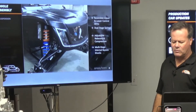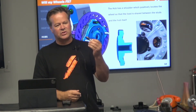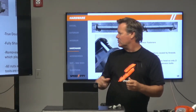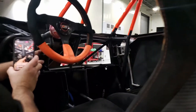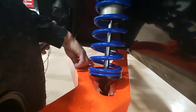Shoulder bolts everywhere. We've tried to explain the double shear concept a lot, but this is just a shear point — same thing with our bolts. Not only the bolts, we actually register the hub into the wheel itself. Sway bars are in double shear. This is a double shear dual adjustable sway bar, so you can soften or stiffen your suspension. The brake master cylinders are in double shear mounts.